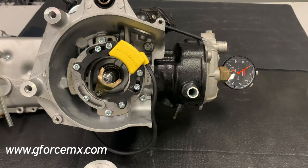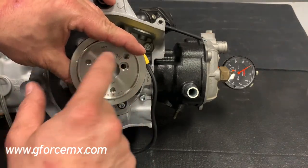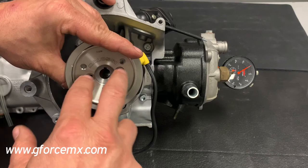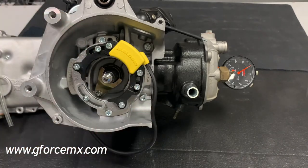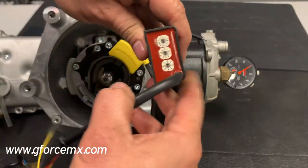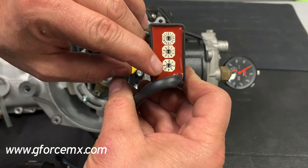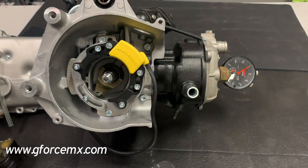It's just like any other ignition — even the stock one — it's got a drive plate just like that. You put that on, then you have your three little water pump drivers if you're using that kind of setup. You'd still have your regular M10 by 1.25 nut to secure it, and then put your three water pump drive studs in. The two holes are for Allen bolts that attach the drive plate to the rotor. You also have your CDI box, which has three different settings: a rev limiter, an initial advance curve, and eight different ignition curves. The manual shows which one to use based on your CC.